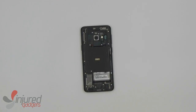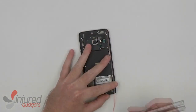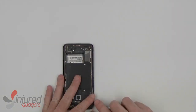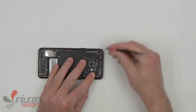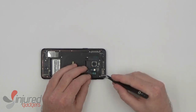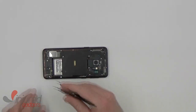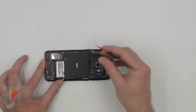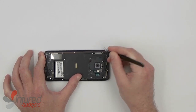Now, to replace the glass backing, we'll use our 2mm red tape, also available on our website. You can pretty much just cover each side in a stripe or two — I used it a little lightly, but you could do two stripes without issue. Here I'm simply removing the backing of the tape — it is double-sided — before reapplying the glass back.